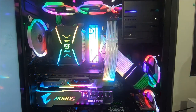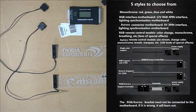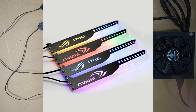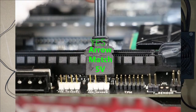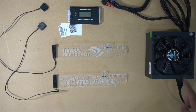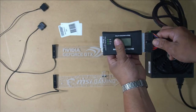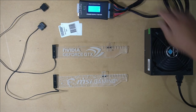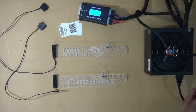I'm also going to show you these two other GPU holders that I bought. Here are some other basic ones — they simply run off a Molex cable. You can buy ones with specific colours, or ones with full RGB lighting and a controller so you can control which colour you want. If it also has a 5V 3-pin plug, you can plug it into your motherboard's 5V 3-pin header and control the light via the motherboard. I also want to show you a power supply tester — you can plug your PSU into it, it jumps the power supply so it turns on, and you're able to test any of the cables without plugging everything into the PC.